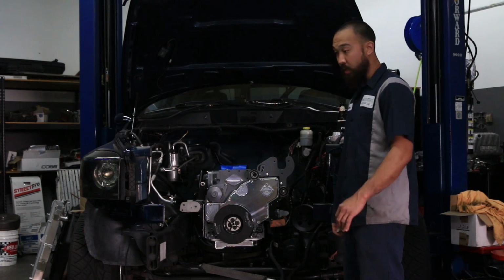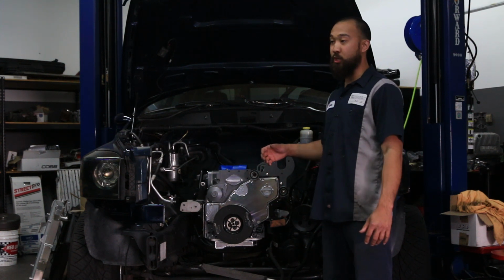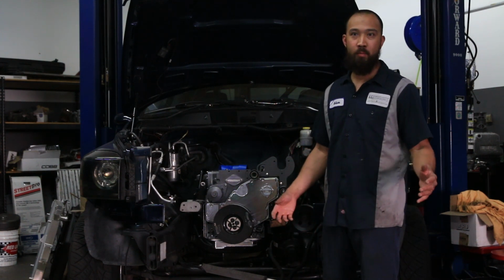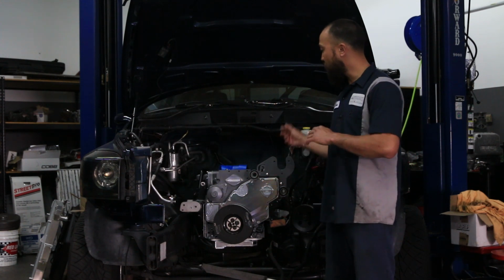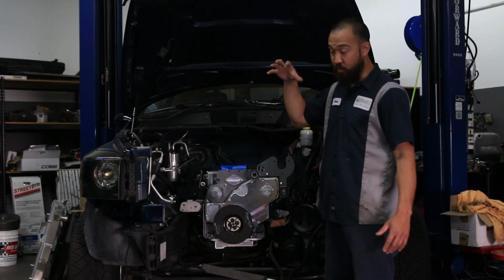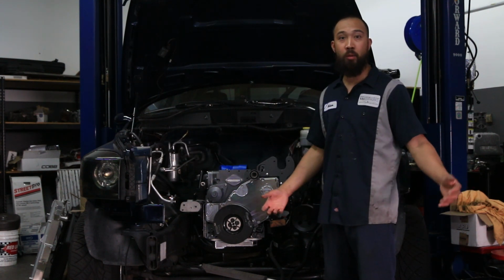One of the biggest things that I had a question on was sleeves and how to go about sleeving it properly. Contrary to what Chase from Chase Fleece said I should do, I still went with stock bore 6/7 sleeves. They're custom spec'd by basically what I dreamed up in my head as a safe thickness without removing too much meat from the cylinders. It's a sleeve made by LA Sleeves, spec'd out to my specs. It has a flange on top, so it actually locates on top of the stock parent sleeve, and allows for enough meat to cut a fire ring, and the fire ring actually sits on the new sleeve. So it's kind of a cool deal. Hit me up if you want them. I can get you a set.